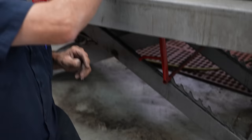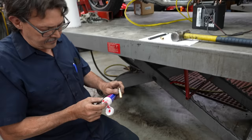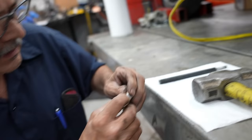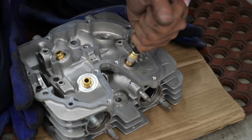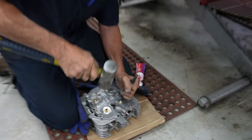I'm going to set this on the floor. These just came out of the freezer — they've got a little Teflon tape on them to make a little seal when they seat into the top of the head. It comes with an O-ring, but it just mashes the O-ring out. I'm going to put a little assembly lube on the guide too.